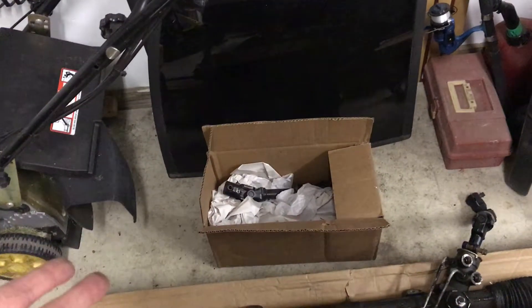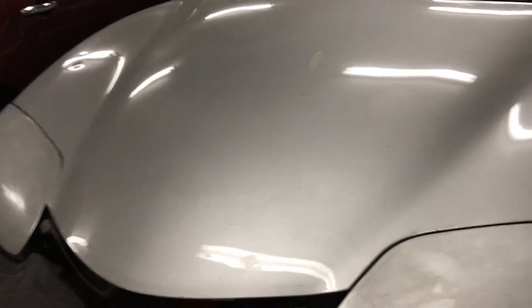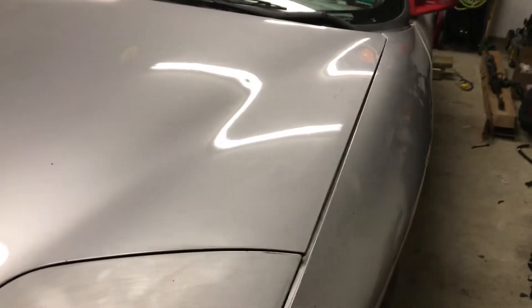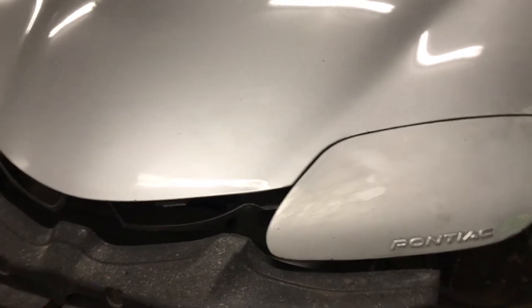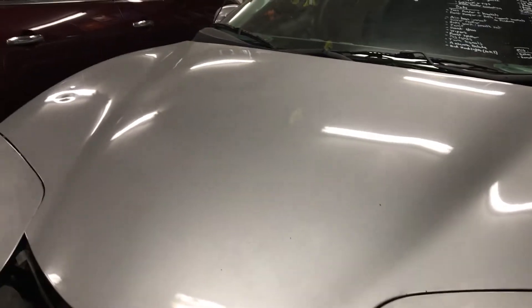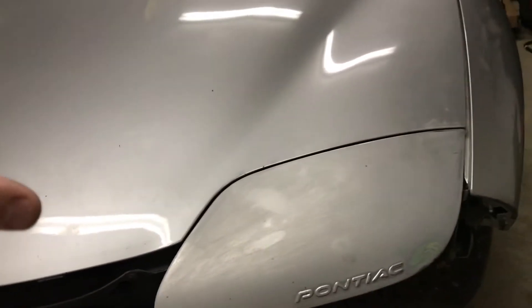I got the power steering lines and they'll hook up to the stock truck power steering. And for everyone who said the stock hood on F-bodies won't work with truck accessories — that's a load of bullshit. It fits just fine. At least on a fourth gen Firebird, 1998 to 2002, the stock hood will clear the truck accessories, so don't waste your money. If you just want a functional, lightweight car, use the stock hood and truck accessories — even the radiator in the stock position fits fine.